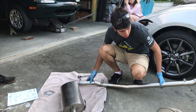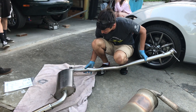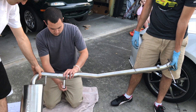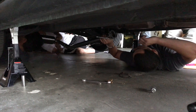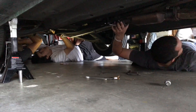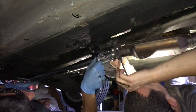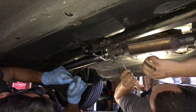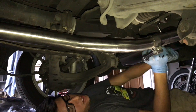Once we had that done, we connected the muffler to the pipe using the included hose clamp. We didn't tighten it all the way; we just kind of got them connected. And then we went under the car and made sure that the exhaust was in the correct position — everything was at the right angle to attach it to the hangers. Once that was done, we were able to fully tighten all the bolts going into the catalytic converter and going between the pipe section to the muffler, and that way we were sure that it would fit. So make sure you don't tighten that early.